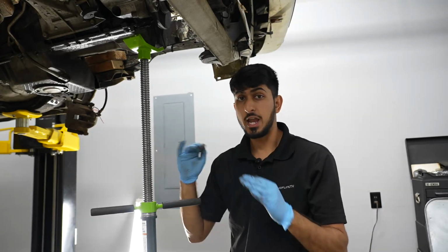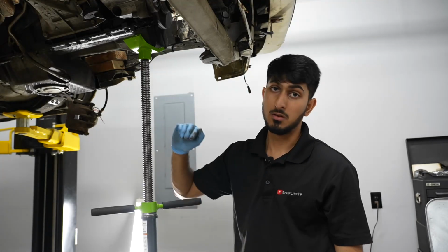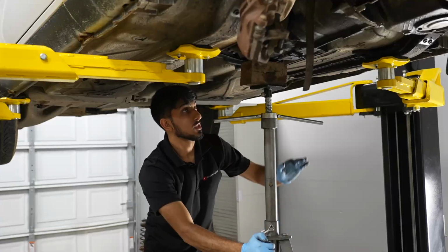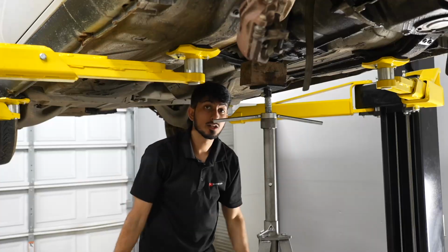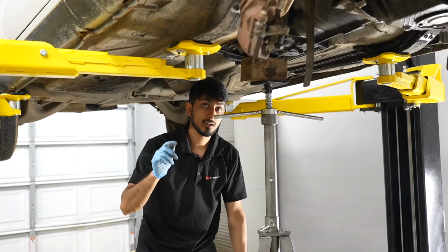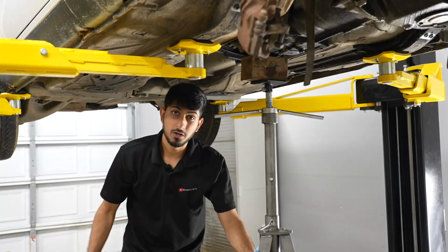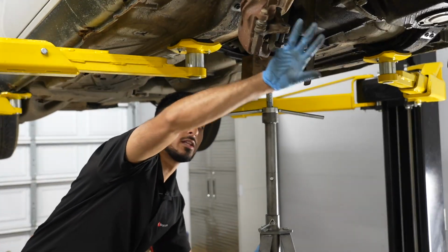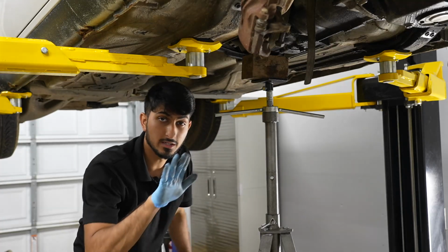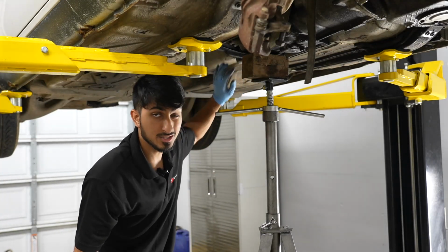The only thing that's still going to change the level a little bit is the transmission, so we're going to do that next. First, we're just going to bring this down onto those custom 2x4 engine mounts. The manual crossmember is not going to work either, mainly because the transmission is just in the way. I know they make an adapter to make the E30 crossmember work. I'm going to need to look into that a little bit. But now that we have the engine sitting on those 2x4s, it could support the transmission as well, because it just wedges itself against the firewall. We still have this crossmember in place just in case.